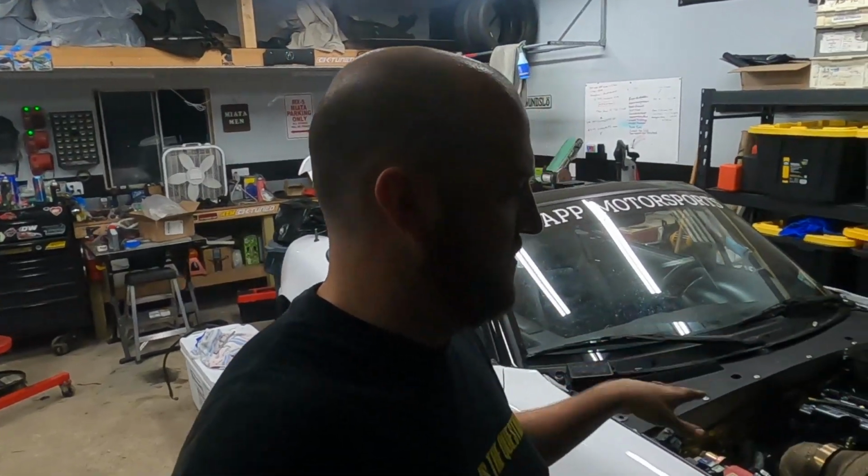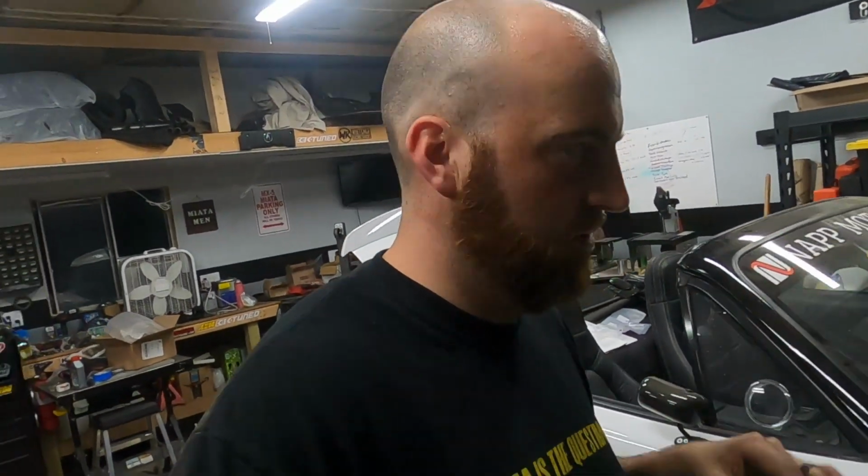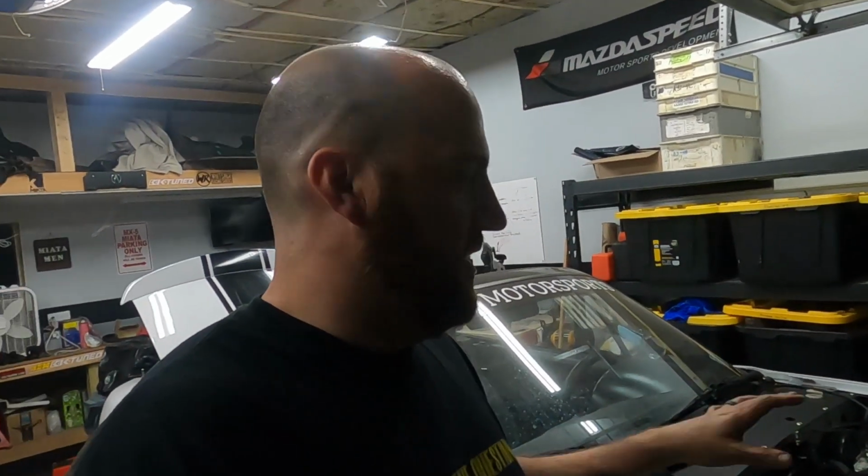So it sounds like it's all coming from the transmission. I think it's just the fact that it's not bled, so it's probably sitting somewhere weird and chattering back and forth. I took a crowbar and touched it to use it as an earpiece, and the engine sounds really smooth. Nothing's coming from there. The exhaust is not leaking. I thought it was a little exhaust leak because of the way it's puffing, but I'll bleed the clutch tomorrow.